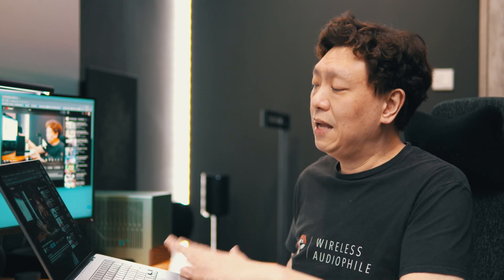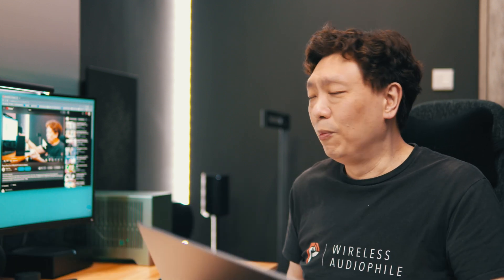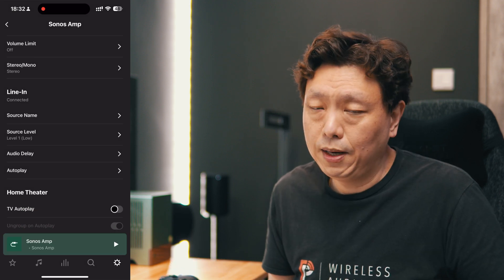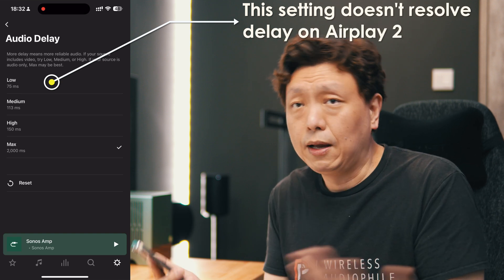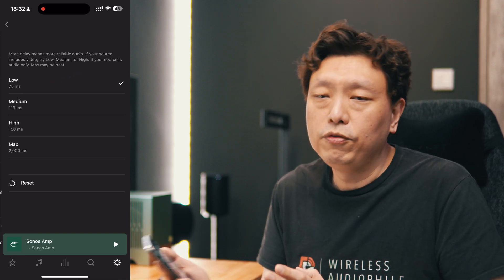I don't actually know exactly how AirPlay works, but I know that if you want to get sound to match between audio and video content on the screen, you're going to get serious delays and the PC won't feel responsive when you click play and stop. There is a setting within the Sonos S2 app that allows you to set audio delay, but note that this setting does not affect the AirPlay 2 implementation — so whether you set it to 75 milliseconds or 2000 milliseconds, it doesn't remove this problem.